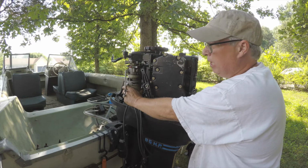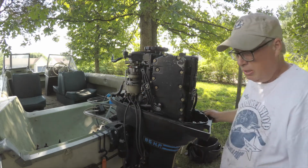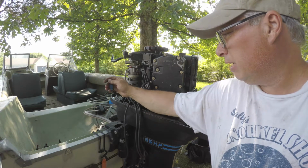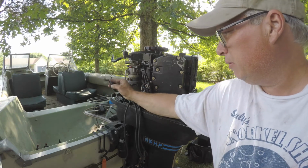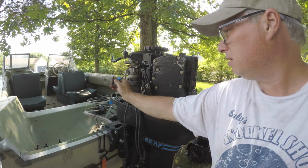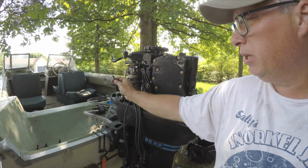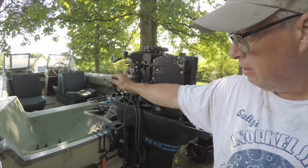Although, when I measure it by ohm and resistance, which I could do real quick and show you, but I just did a video like on the Merc 500, but these are a little different. So, like from here to ground, you'll have continuity, and then I think from here to ground we got continuity, and if I remember right, it's about 1K resistance, and nothing on the white wire. So I don't know. This is my issue. Is this white wire, I think, the trigger wire? I think once the voltage goes through these guys, it sends it out this wire to the switch box, and that's what tells it to fire.